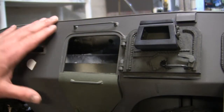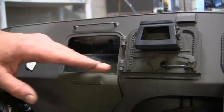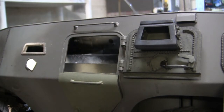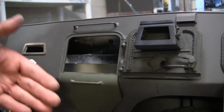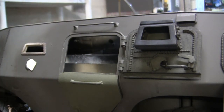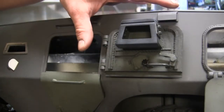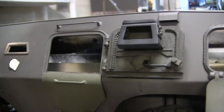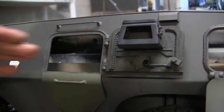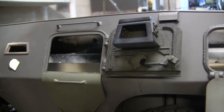One very viable feature of this vehicle pattern is how the hatch is designed — the V100 side hatch is divided in two and opens separately. On the original prototype Commando, it had only a single smaller hatch in this area, but at some point it was opened up to aid entry and exit from the sides. With this design you can operate the vehicle with the hatch partially open. The upper portion just hinges sideways and — unlike the bottom hatch — has no spring-assisted feature; it's loosely hanging on its hinges and doesn't need a counterbalance system.